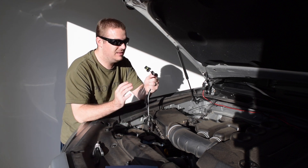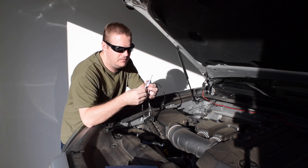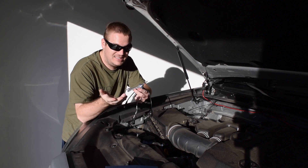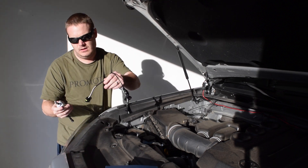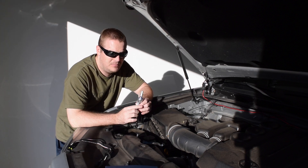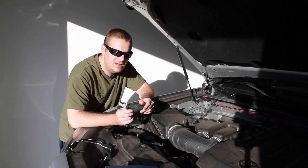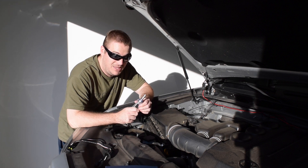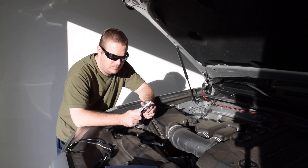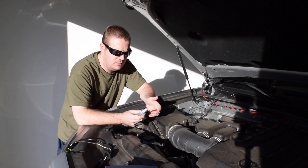The thing about HIDs versus LEDs is this: a halogen bulb gets you 360 degrees of coverage, and a HID does the same thing. LEDs tend to have a problem hitting all of the reflector and just don't get the distance down the road versus an HID. I had Pia LEDs in this truck before, and I'll put the link to that driving video in the description below, along with links to all the driving comparison videos for the 4Runner so you can compare them back to back.